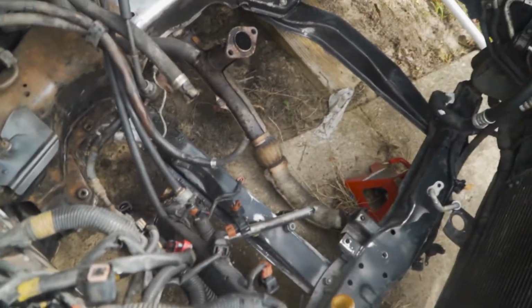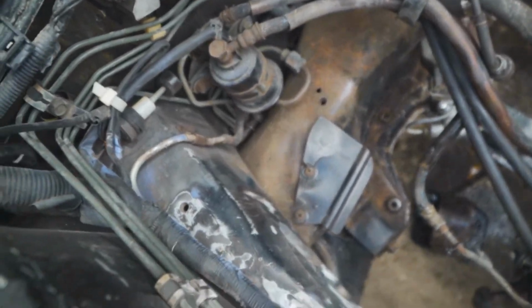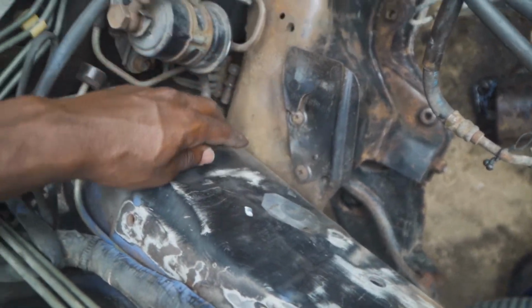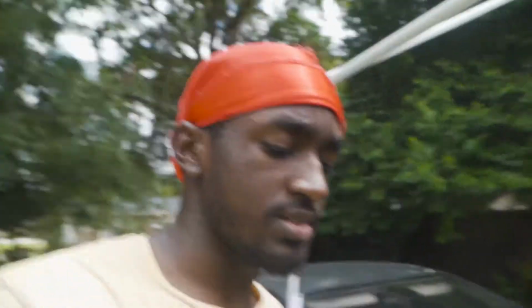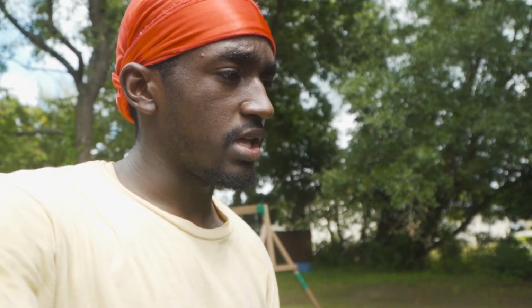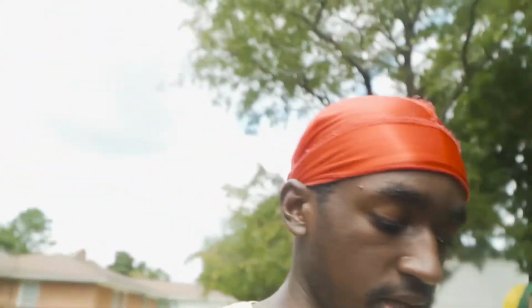Alright, so I've done a decent amount of work, as you can see. For this spot, since there is a lot of heavy rust, I think I'm gonna just hit it with the undercoating and make sure I get it all up in there, and don't really have to worry about scuffing it up and getting all the rust removed, because it'll actually stop it from rusting. It's just gonna be a lot better to do it that way than just throwing gloss black over it, because while the paint will make it look good, it won't help it stop rusting like the Rust-Oleum undercoating will.